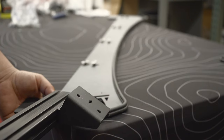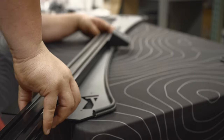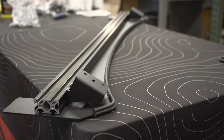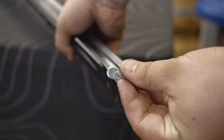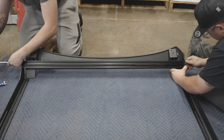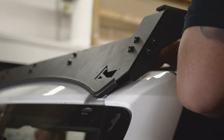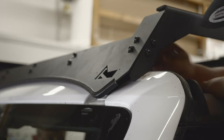To attach the wind deflector, first add the T-slot nuts with a half-inch hex drive bolt and black oxide washer — add one to each slot, there will be 10 in total. Leave them loose, then slide the T-slots into the extrusion. If you chose the light bar cutout option, this is a good time to add the T-slot inserts so you can mount your light bar after the install. Now attach the front extrusion with the front mounting brackets and the wind deflector back to the front of the rack. With the front extrusion reinstalled, place the rack back onto the Bronco and use either the factory bolts or the provided nylon nuts to mount the front mounting brackets into place, then use a 5/32-inch allen key or socket to tighten down the wind deflector.